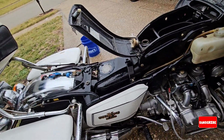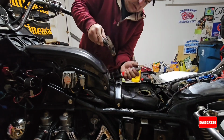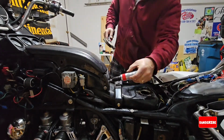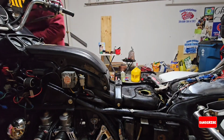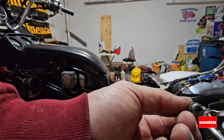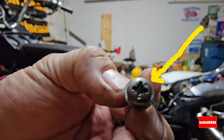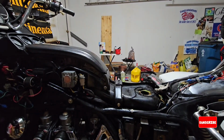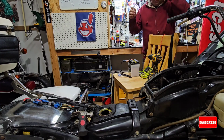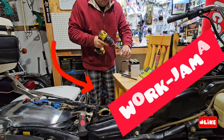So basically, the motorcycle is washed. I dried it with air, and in order to remove the gas tank cover, that is not a gas tank, I need to use an impact driver because these bolts were secured. When you see a dot like that one, it means it's a JIS bolt, Japanese Industrial Standards, something like that. Those you have to use the proper tool for.